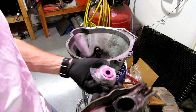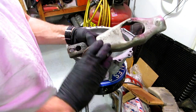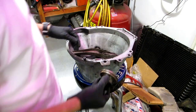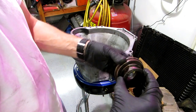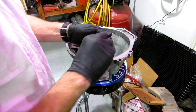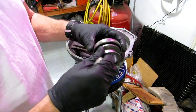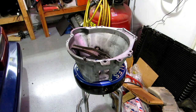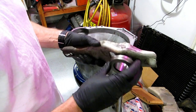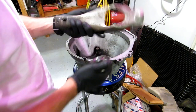We'll get the new throw-out bearing and take off the old one. This is difficult stuff. The old one is shot - you can hear it. That's why we've got a new one. Not to mention the clutch - it's a high-pressure clutch. The new high-pressure clutch is going to require a quite a bit heavier duty throw-out bearing. Also make sure that this slides nice and easy along the input shaft - and it does. Just like that, new throw-out bearing - nice and new.